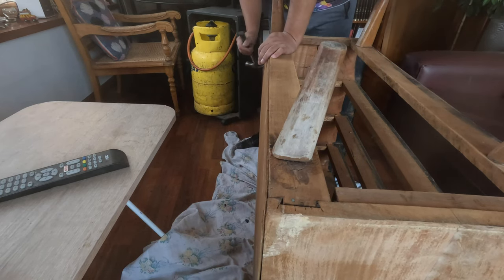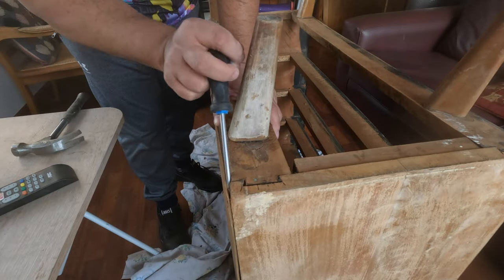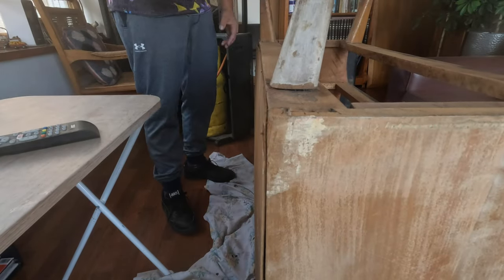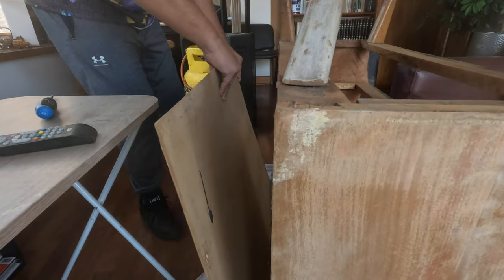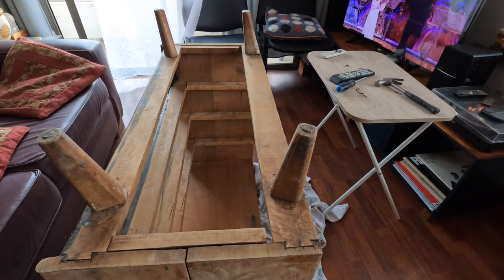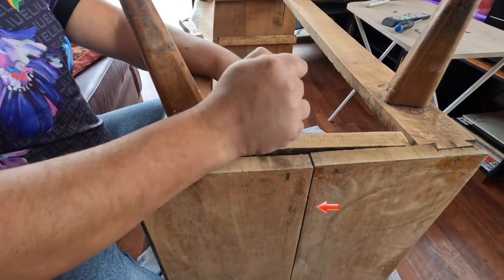The back panel is bent outwards, and it isn't properly attached. I will also turn it over and use the interior part outside. These runners protrude from the inside. That's what prevents the back panel from being flush. I'll have to trim them. I need to remove all the runners that keep that crack open.